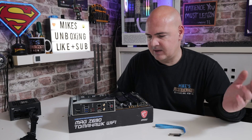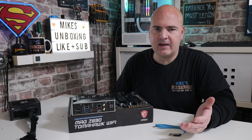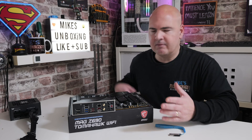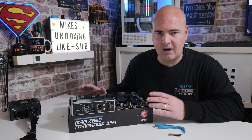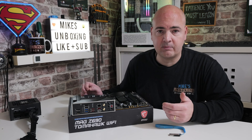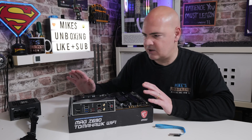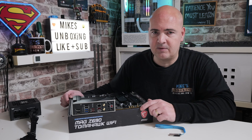Something to put your motherboard on makes life a little bit easier. If you've already built your PC and you're finding it's not working with your 13th or 14th gen processor, you can do this in a built system, but ideally for fault-finding — should anything go wrong or the flash process not work — a board on its own on a cardboard box with just a power supply is the best way of doing it, in my opinion. But do whatever works for you.